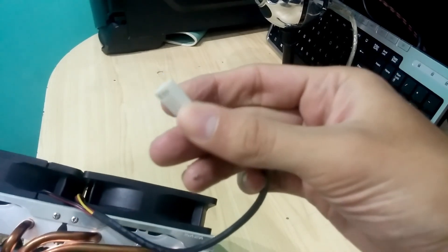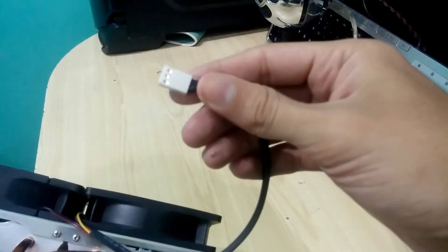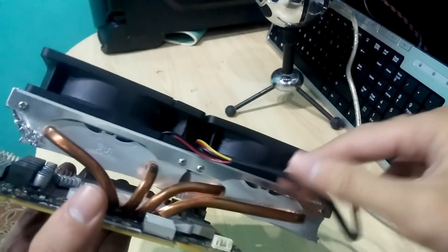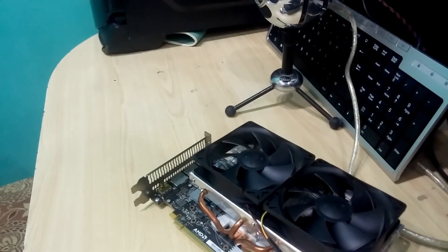To fix this, I applied small metal washers — available at any local market — using double-sided tape, placing them between the VGA cooler and the rubber insulators. Important caution: do NOT place the metal washers on the GPU screw holes themselves — only between the VGA cooler and the rubber insulators. Credit for this washer solution goes to a person on a forum, which I'll link in the description. Also, the red washers included go on the back of the GPU between the screws and the PCB.